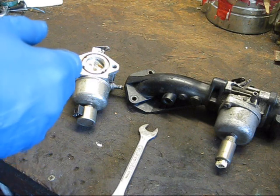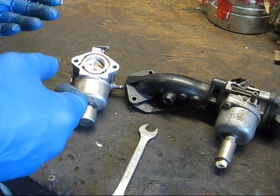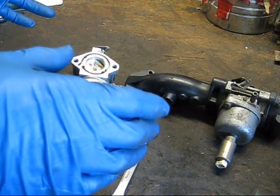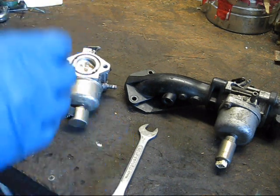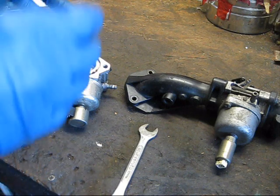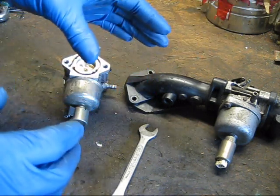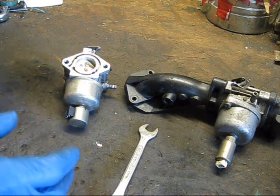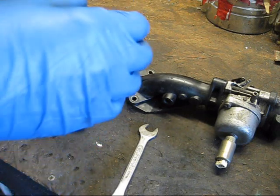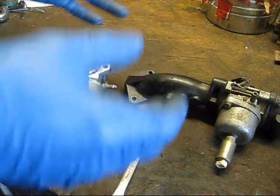When you turn off the key on a riding lawnmower to shut the engine off, what you're doing is grounding out the ignition coil, which kills the spark to the engine. This doesn't stop the engine right away — it doesn't bring it to a grinding halt. When you kill the spark, the engine still has momentum, so it's going to coast down slowly to a stop. While it's coasting down, the piston is still moving, the valves are still moving, so the engine is still going to be drawing fuel in from the carburetor, pumping it through the engine and into the exhaust. When that happens, when it pumps the fuel and air into the exhaust, it combusts in the exhaust because the exhaust is very hot, thereby creating a very loud and irritating backfire.